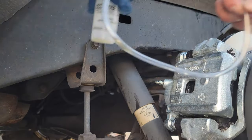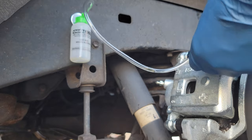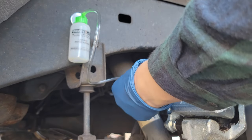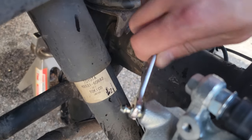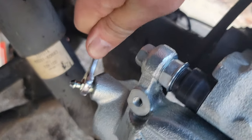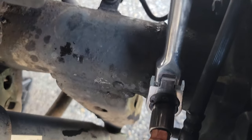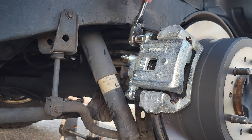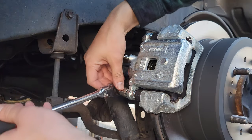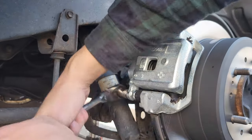This next step is mandatory — you do have to bleed the brakes. I'll link a video on how to do that right here on the screen, but you have to bleed the brakes to get all the air out of the system or else your braking system will not work properly. Once you get the brakes bled, come back to this video and we'll tighten up all of our bolts: the bleeder valve all the way tight, the banjo bolt so we don't get any brake fluid coming out, those two 14 millimeter bolts that hold the caliper together, and then the two big 17 millimeters that hold the caliper to the hub.